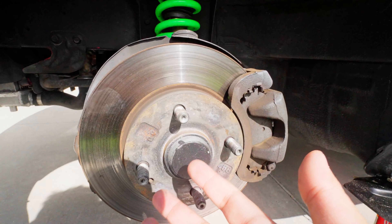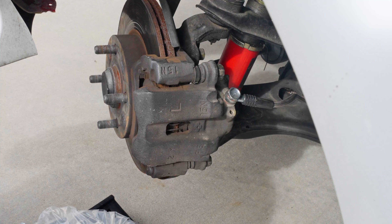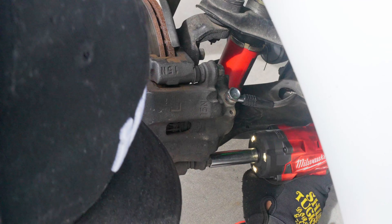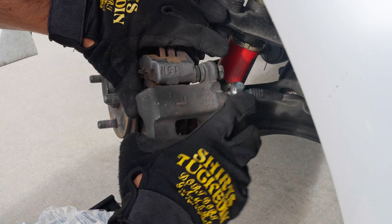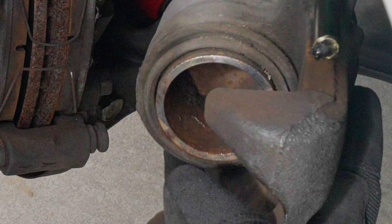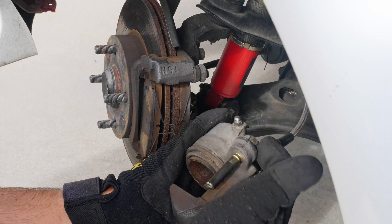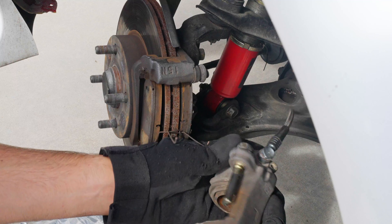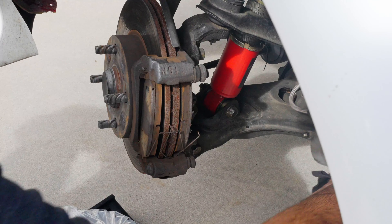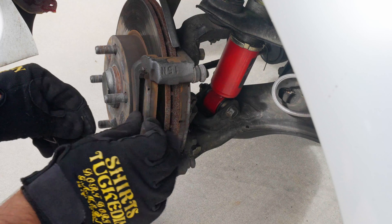You can just replace your pads, but I recommend doing your pads and rotors so you don't get what's called pad slap. These rotors are long overdue for a change, so we've got the new equipment right here. Getting this off, I'm using an impact on the bottom bolt just because I don't want to spend time trying to break it loose next to the lower control arm. You don't have to use an impact. It still had grease on it which was awesome — I at least know the front was maintained by the previous owner. Please do not impact off that top bolt. You can see where the previous owner tried to put a wrench on it — not a good idea because that does not thread out. That is just a sliding-out piece, so I'm just going to set this on the lower control arm to keep tension off the brake line. Then just remove the retainer pins and remove the pads.